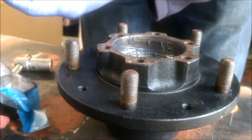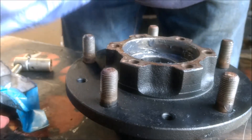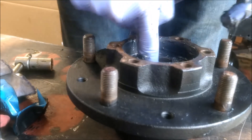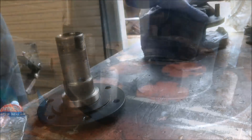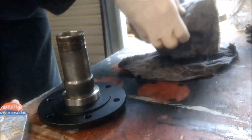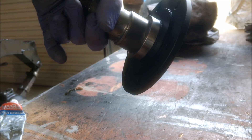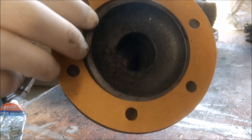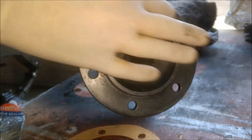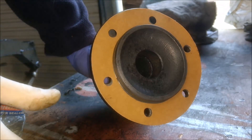We've got the top bearing — that'll go in there. I'll actually give this bearing a bit more grease as well. So with the hub completed and ready to go, bearings are in there, all looking good. Next step is to put the stub axle onto the swivel housing, but that has a gasket. What I usually do here is I put RTV on this side to basically stick the gasket on, and then on the other side where it mates up with the swivel housing I put grease.